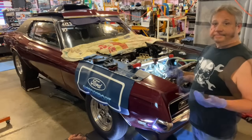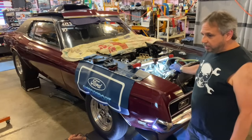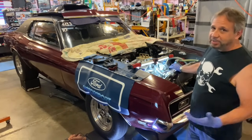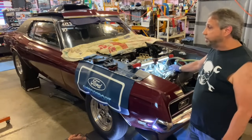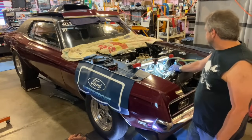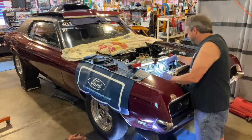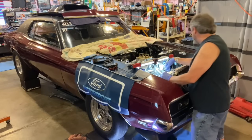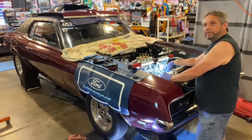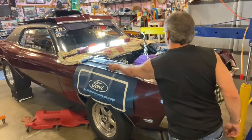That's kind of where we're at. But a lot of parts on this engine are old. Pistons are 11 years old, been beating on this block for 11 years. The roller lifters are 11 years old. I know they need to change. Had good luck with Crower Ultra Pro lifters, if they even still make them, so probably made by some Chinese company. But I'll let this thing drain, and we'll pull the hoses off, and we'll get this engine out.